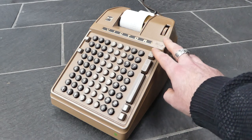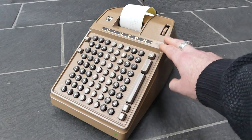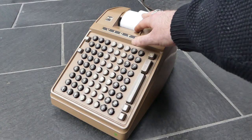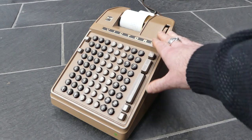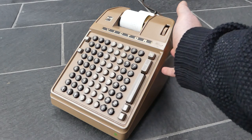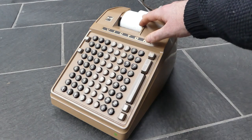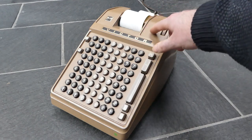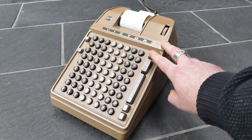The N button is non-add, so if you enter a number and press the N button, it prints it with an N at the end but doesn't add it to the main register. Unfortunately this doesn't work reliably on this machine — it usually also adds it to the main register, but it doesn't always work on this machine.